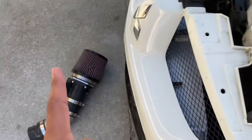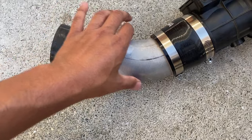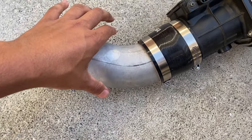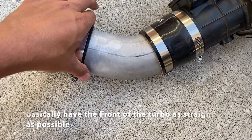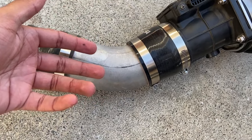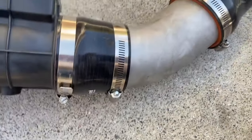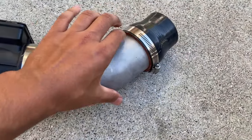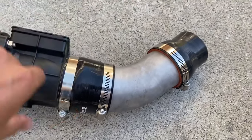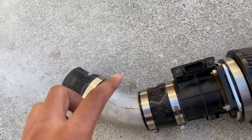The first thing you need is a nice straight intake pipe, because if it's straight it can help the engine breathe a lot easier. A straight pipe right before the turbo is going to help it spool a lot better — which is basically what causes the flutter — and it's also going to make it louder. I had this intake reversed, where more of the straight section was facing up and the bend was right in front of the turbo, so it wasn't as good as it is now.